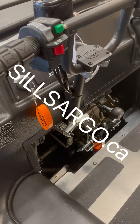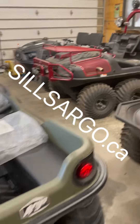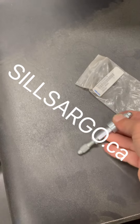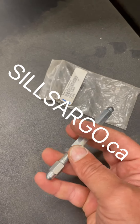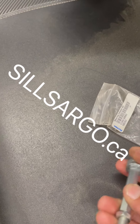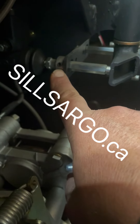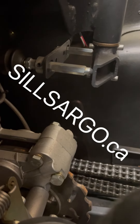That's the same adjustment process for a Frontier as for an Aurora. The older style steering — say on an Avenger — uses a solid push rod instead of a spring, so there's no spring to it. But it still adjusts in and out the same way, and there's your lock nut there. This little collar just goes on with a set screw after it's all adjusted, and it goes in against the back of this plate so that when you turn the handlebars the push rod doesn't fall out.